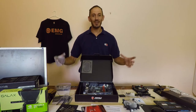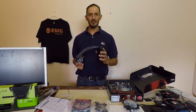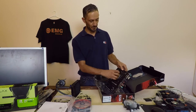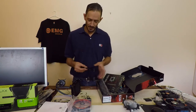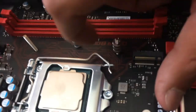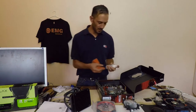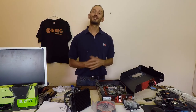With the CPU seated, we can now put the water cooling onto the motherboard. Prior to fitting the water cooling unit, we want to roughly estimate where and how it's going to sit in the case. When installing your all-in-one water cooler, ensure your radiator is fed from the top — this reduces the amount of work your pump has to do. When fitting this particular water cooler, you'll be applying the back plate first. You can find where to put the screws through in the instruction manual, which will tell you the correct fitting for your socket, as every socket will have a slightly different fitting. We want to ensure that your CPU surface is clean — use isopropyl alcohol to clean it and a static-free cloth. This ensures efficient heat transfer between the CPU cooler and the CPU, keeping components cool for a long lifespan.